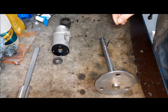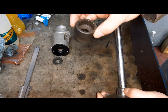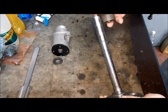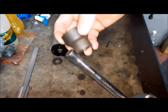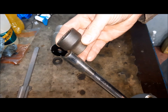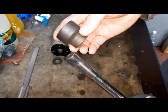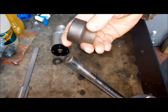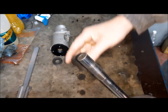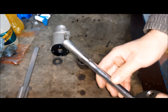These are the parts. As you know, this part is a coupling part, and it fits here, but there are no splines. It enters here pressed, but with some heat, and this way when this part cools down, it will tighten very strongly on the shaft, and this way it will not rotate on the shaft. This was the system in those years.